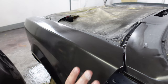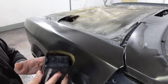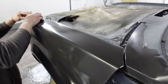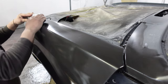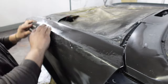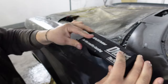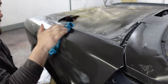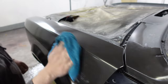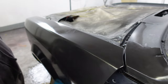We've done down here and along here - it's all looking very nice - but we haven't done this little section this way. So we're going to use the 600 again on the Dura block, make sure it's wet, and just work over it like that. Don't stay in one place. That should probably do it. Looks good guys - the wing is done. We're going to do exactly the same on the rear quarter, and then this car is quite ready for paint. We've got a lot of masking to do - that's the next episode though.